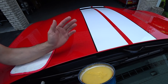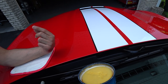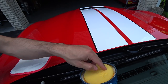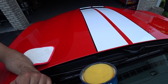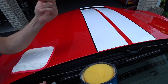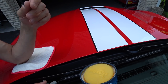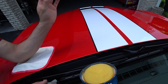That's pretty much what I do over the summer when there's a lot of dust and pollen from May to the end of June. If you get any debris from the sky — dirt, dried leaves, bird droppings — don't wax over it, get it off the paint first. If your pad gets contaminated, get another one — don't try to clean it out, just throw it out. Do panel per panel, split the hood into two or four quadrants. The roof and trunk you can do in one shot on most cars. For doors on a sedan, do the top half then the bottom half.